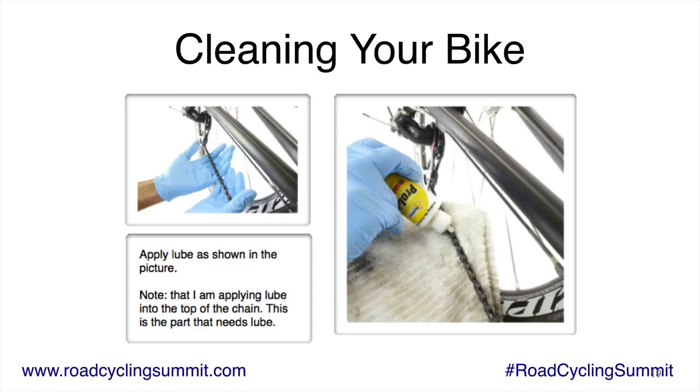So my method is you take your rag, in that right hand picture. I hold it around the chain, because I don't want to get that lube on the brake surface or the tire. And so I put a drop in each link. You see right where the dropper is there on that little roller? That's where you need the lube. You don't need it anywhere else.